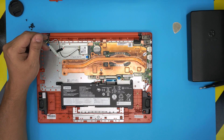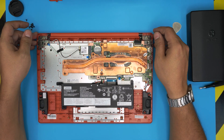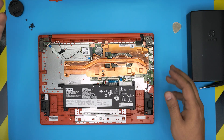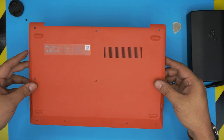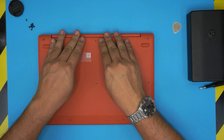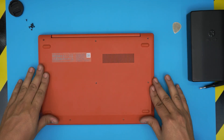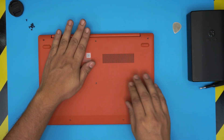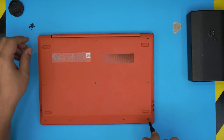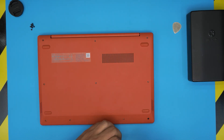So there you go — I've shown you the inside. There's nothing you can do regarding the RAM. If you were thinking you could buy this laptop and increase the RAM, you're out of luck. To put it back together, grab the bottom cover, snap the sides, push down hard on the back side, make sure you hear those clicks on the front and sides, then put the screws back in. Thanks for watching and I'll see you in the next video.